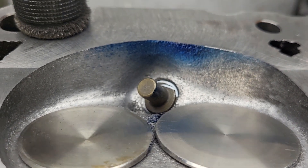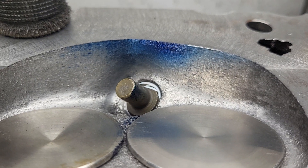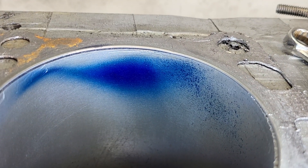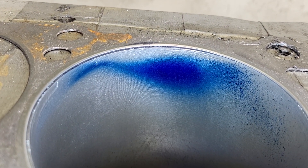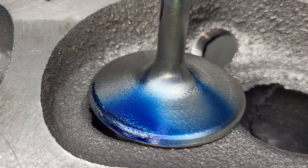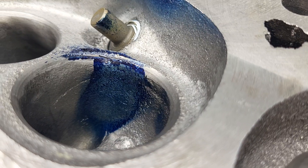The roughness did make our powdering on the chamber quite nice. Let's take a look at the bore — the bore looks quite good. There's definitely power there. Remember, this does have a textured intake valve, which definitely helps. Our valve looks quite good. We've got a lot of blue on the other side, and a nice wide spread on our center of cylinder.